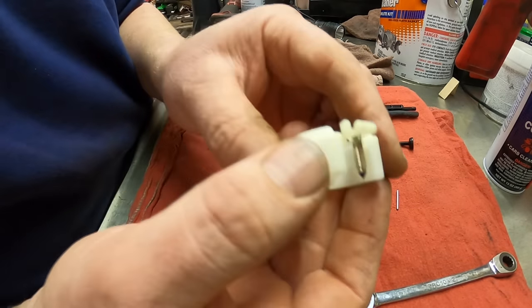10 millimeter wrench, tighten that up. That's good. This, I already ran the torch tip cleaner through, and I blew everything off with the air blower. So now there's a flat spot there. And this has 2 flat spots. It doesn't matter which way the flat spots go, as long as the flat spots go in, you just push it into the hole, make sure it's somewhat lined up, and push it back in, and it went all the way back in.